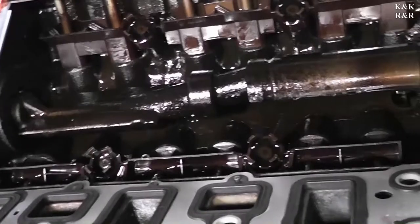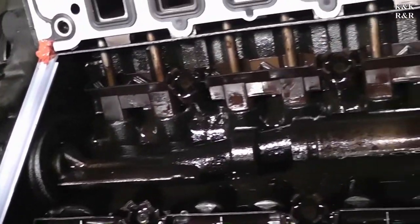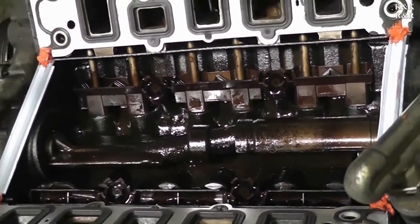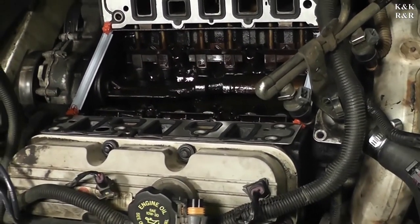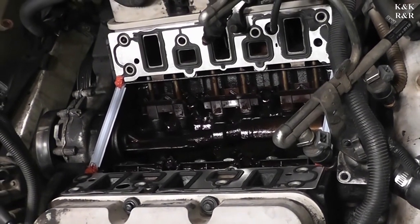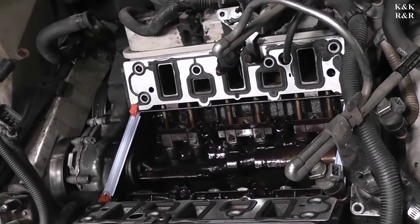If you had oil or coolant ingestion, run some oil through here, make sure you've got good clean oil, and if there's any bad oil get it to the pan — change your oil. Don't even start this with bad oil. You're going to want to do a couple of premature oil changes: every 2,000 miles or every two months. We might recommend sooner for this one — maybe one month, then two, then normal intervals after that.